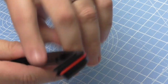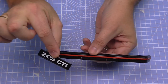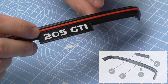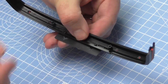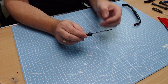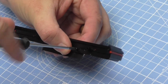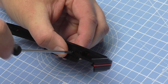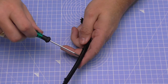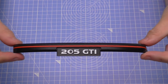The lugs hold it in with no problems at all — make sure you put it in the right way so it follows the line of the fender on both sides. Next I'm going to put the registration plate in, which goes into these holes at the front. Make sure you've got it facing the right way, then secure it from the other side with AP screws. If a screw ends in P, it means it's going into plastic — so no oil needed. We only use oil when it ends in M, which stands for metal.